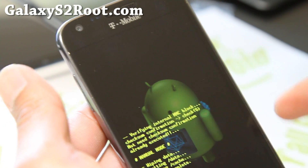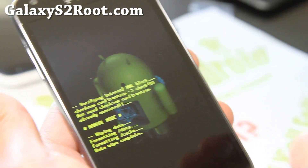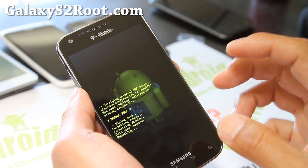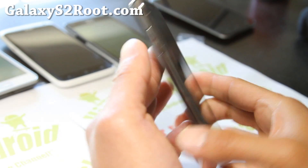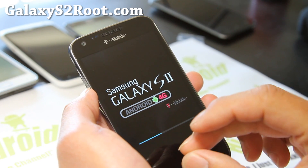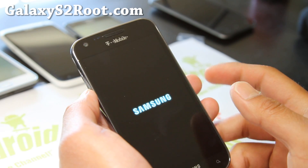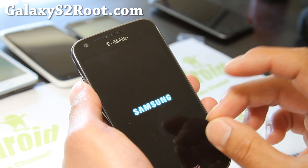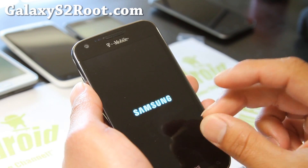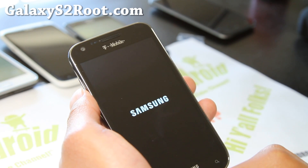This is the stock recovery. To root this phone, we're basically going to install custom recovery. Only the T-Mobile version has a separate recovery on the Galaxy S2. That's why this one is actually safer than all the other Galaxy S2s — this one doesn't have the Samsung Exynos processor. With the Galaxy S3, all versions will come with a separate recovery, just like this one, which is safer — like the Galaxy Nexus method. A lot of bricks on other Galaxy devices are caused by the kernel being included with recovery. If it's separate, you can boot into recovery and restore your ROMs if something goes wrong.